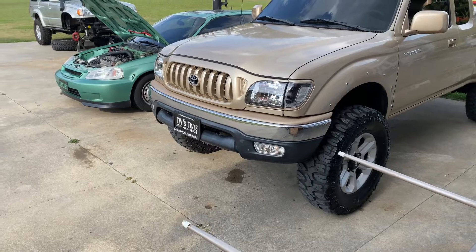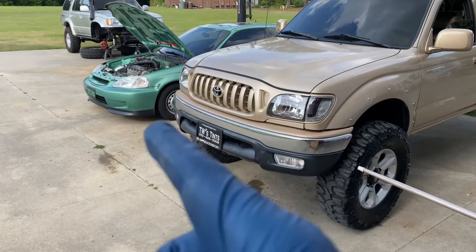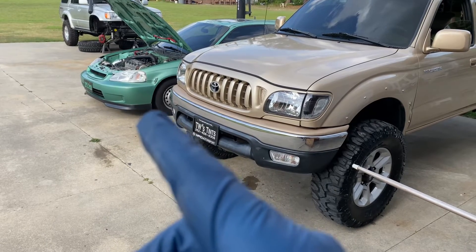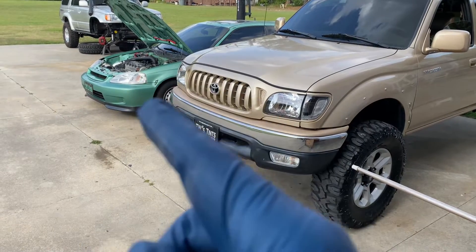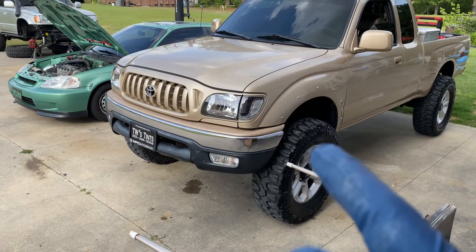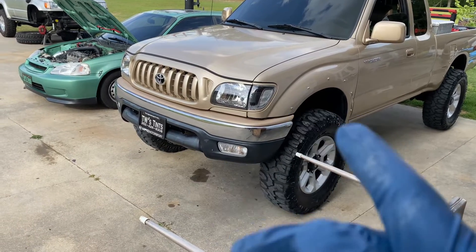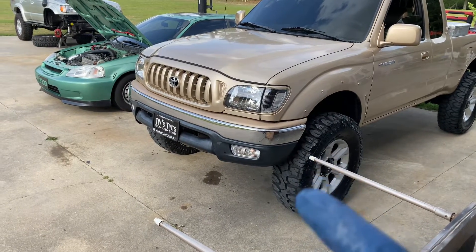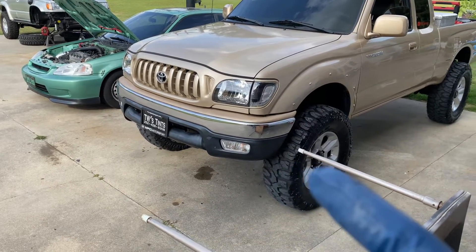All right boys, I found out more problems with the AC on the Tacoma and the Civic. The Civic just had a bad relay, but I started messing with the high and low side lines so I just messed up the whole cycle in it — so I've got to put a vacuum on it and redo the refrigerant. The Tacoma — I noticed that Freon is coming out of the compressor, so something's leaking out of the compressor, probably just an O-ring or whatever, so I'm gonna look into that.